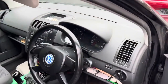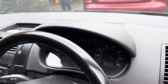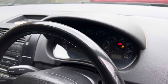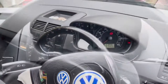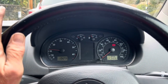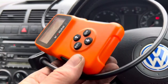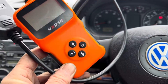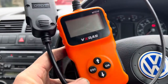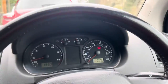Hopefully when we turn the engine on it'll run smoothly and there'll be no engine management light on - let's just try that. There we go, engine running smoothly. If one of your coil packs does fail you will experience very rough idling and a loss of power. If you do ever have rough idling, loss of power, and the yellow engine management light on your dash, here's where we got the part and where you can get one of these cheap scanners.